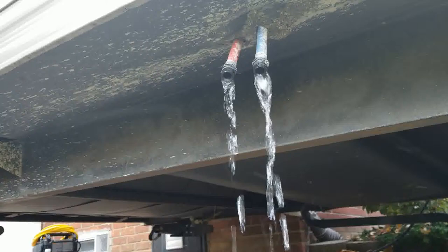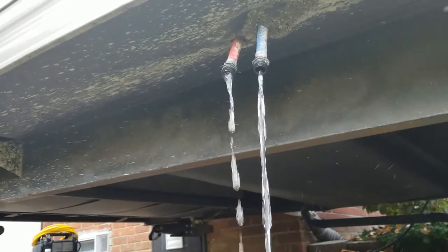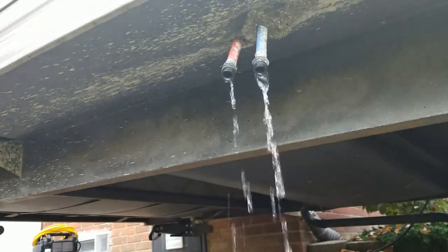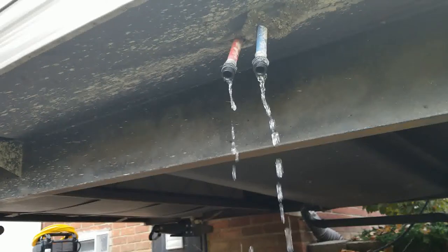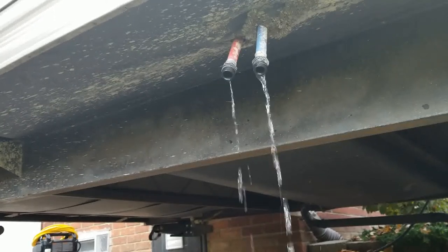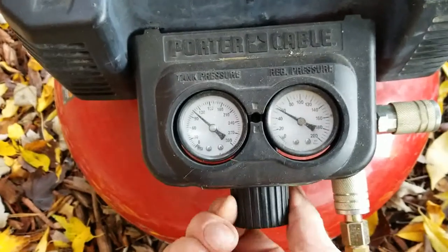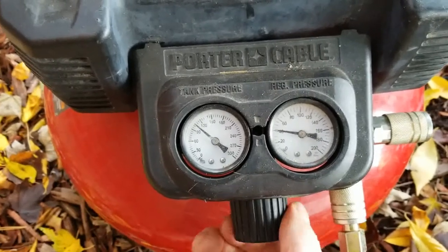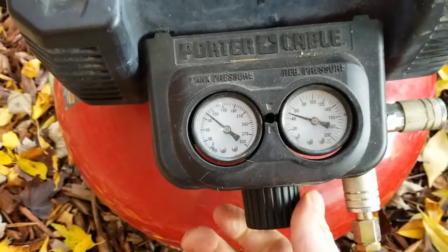Then I'll put these caps back on and open up my hot and cold valves inside the travel trailer as I apply compressed air to the system to purge out what's left inside the lines. If you have a way to regulate how much compressed air you're going to send through your supply lines, that would be very helpful. You don't want to send 100 PSI through there — that's overkill and could possibly damage some of your line fittings. I usually regulate it to 40 or 45 PSI, which is more than sufficient to purge the water out of your lines.